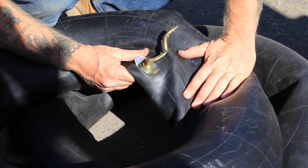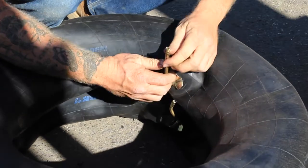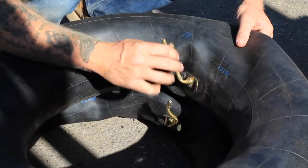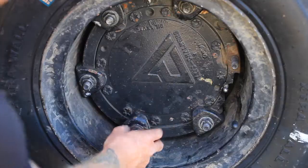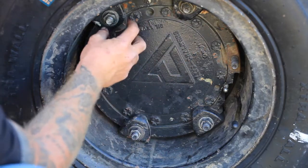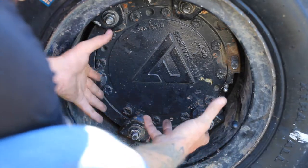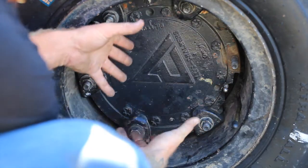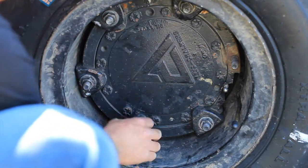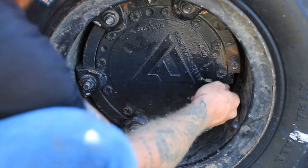This is our problem — that's why we were flat. Look at that stem. These things start off straight. This one completely pinched right here and kinked, and that's why we were losing air. So it wasn't a puncture to the tube, it was just the stems getting yanked. The reason that was happening — these nuts right here are a little bit worn out, so when they're being tightened on, they're not fully getting as tight as they should be. So it's a little bit loose, and what's happening is the squeeze is moving forward or reverse when you switch directions quickly. The hub on the inside is moving because of the torque of the engine spinning, but the tire is staying in the same spot and the hub is moving inside the rim because it isn't tight. They can't get tight, so he's saying to replace these. Because that's spinning in there, the stems were getting caught on the hub because of that.